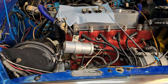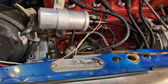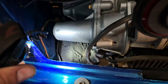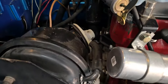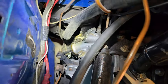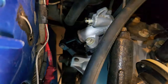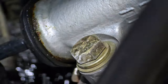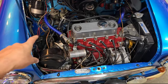While I was working on the ignition system it's now all replaced — new coil, plugs, gaps, wires, cap and rotor — and I cleaned all that debris out of the cap. Looking around I noticed the paint looked bubbled up on the subframe. I looked at the booster, couldn't see any obvious leaks there, so I kept looking and it turns out the clutch slave cylinder is leaking. You can see all the wetness down in the bottom of the subframe, and if you lift up the boot it's very wet and damp. I went ahead and replaced the clutch slave cylinder.